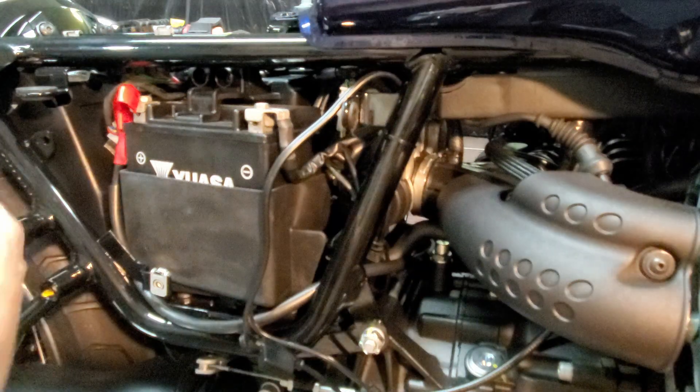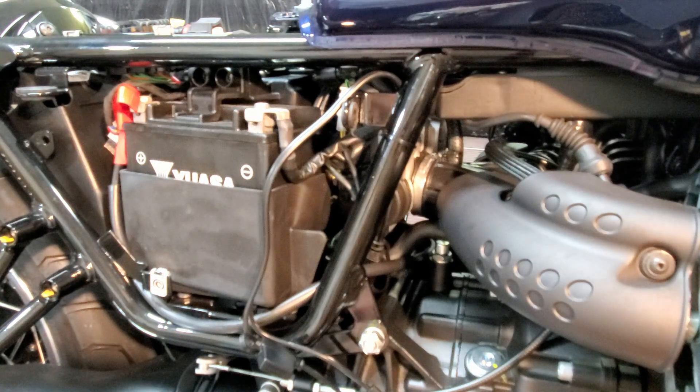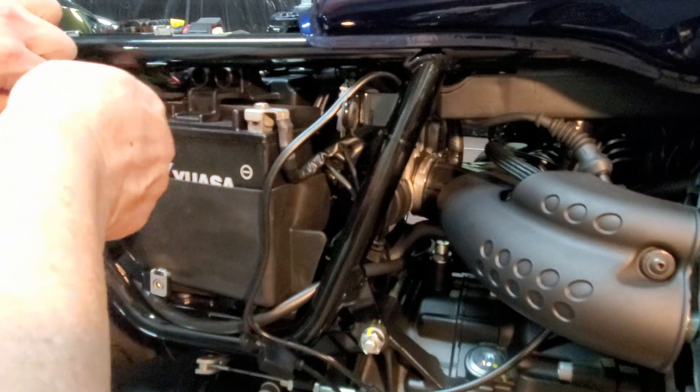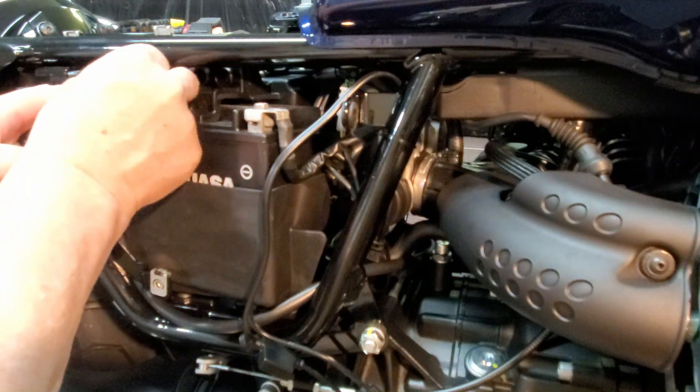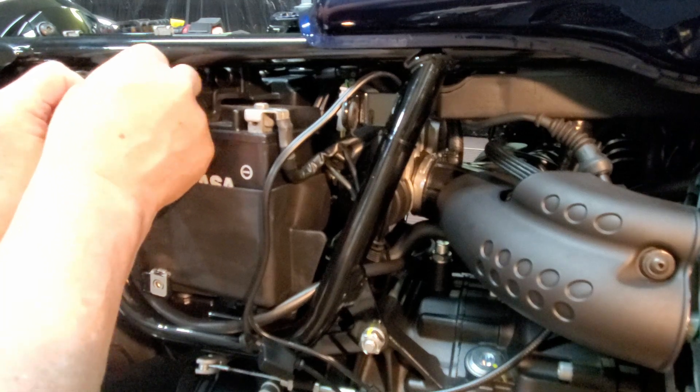I have a 10-millimeter wrench. I talked to Manic Moto, who's the Moto Guzzi dealer I bought the bike from, and I asked about disconnecting the battery — if there was anything in volatile memory that would make that an issue, losing power to the system, if I'd lose anything crucial to operating the motorcycle. They said no. Everything's stored in the ECU or some type of firmware. I probably have to reset the clock, but it's okay to go ahead and disconnect the battery. I'm going to be careful not to touch anything when disconnecting the positive terminal, because I don't want to throw any sparks — electronics are sensitive and you just don't need to be shorting out the positive terminal.